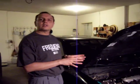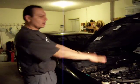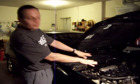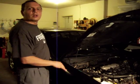There should be a total of 20 batteries in this car — 6-volt batteries for a total of 120 volts. I'm planning to fit 6, 7, or even 10 under the hood, and another 10 or 12 in the trunk. I may need to get stronger springs because all these 20 batteries weigh about a thousand pounds, so at least in the back I'll need stronger springs to hold the extra weight.